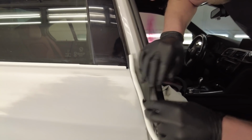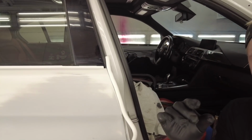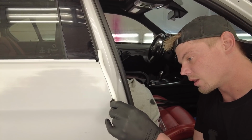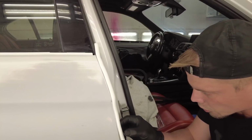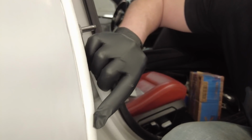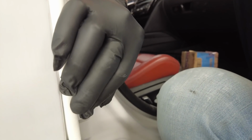And you want to be careful with this stuff. If you stretch it out, it's going to not only get skinnier, but then it will be under tension and you risk it separating from the part that you put it on. And you don't want to put that glue that it has on there too close to the area where you want it to feather, because that's when you get a bit of a line.